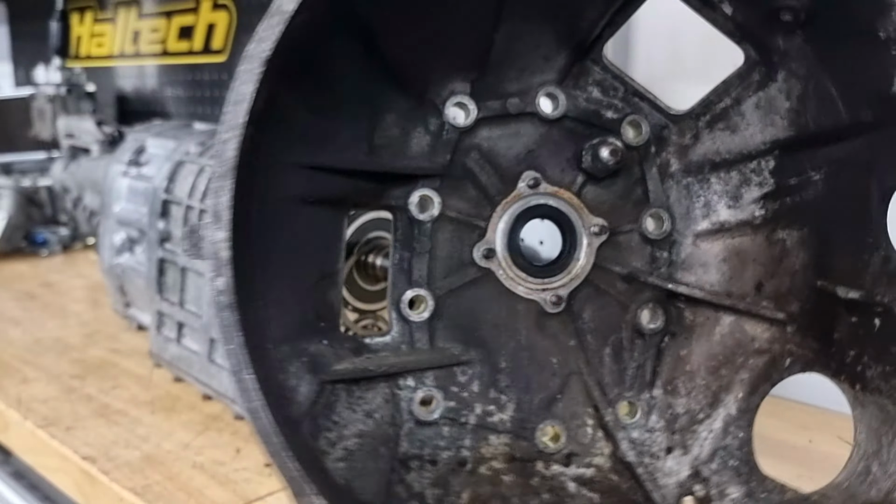As you can see, we'll now raise the motor by about 40 mil. And we'll also shift it back roughly around 50. So those dimensions could change. This may come forward slightly a little bit more, and also this may go up or down, but for the now we can start roughing out our measurements for the cross member and the brackets coming from the chassis.